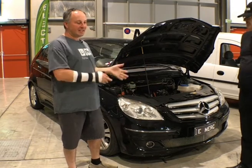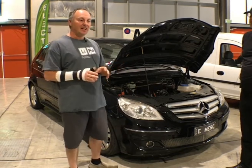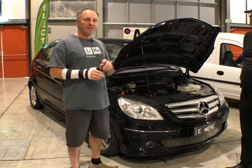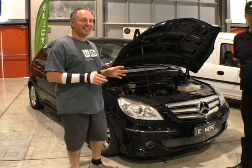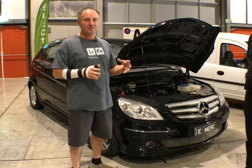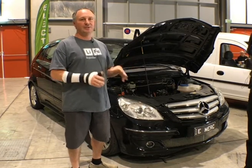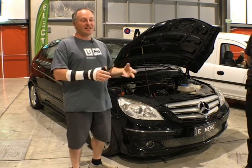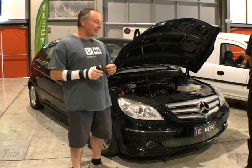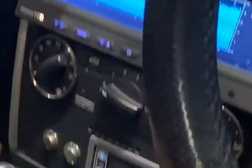Originally, this car was an automatic car — no clutch pedal. The original owner put a manual gearbox into the car and would basically just change gears without the clutch, which in most cars works sometimes, but in this car it really didn't like being changed without the clutch. When I did the conversion and fitted the adapters for the motor and the gearbox, I actually put a clutch in the car — the clutch cylinder and everything. So I made an assembly where you push the button and it disengages the clutch, and then you can change gears successfully. Previously it was okay to start with but got progressively worse until we definitely had to do something about it.